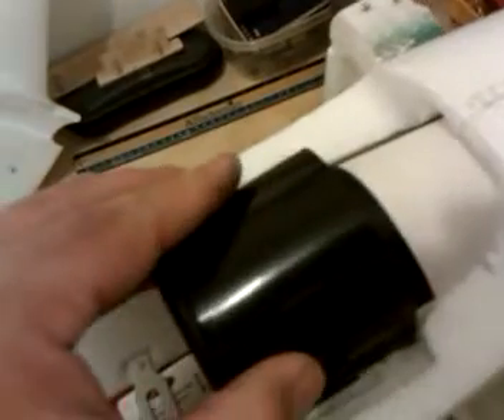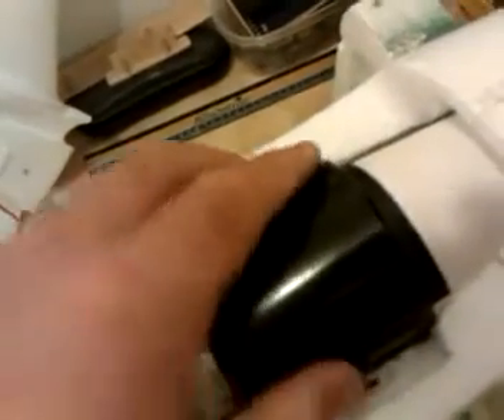Now you just slide the thrust tube back and you see it sticking out the back end. Just take the fan, drop your fan in, connect up your wires. The fan may require a little playing with. The nice thing again about the flexibility of the Mylar or poster board — whatever you choose to use — you can bend it, move it, do whatever you need. Slip the fan in. Bam! Fan's in its stock location. It's not completely sitting down right now because the wires are not hooked up.